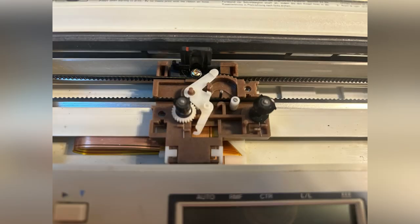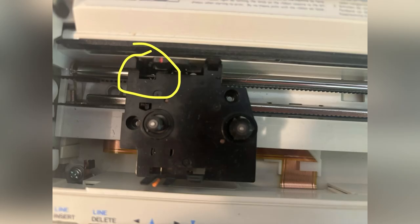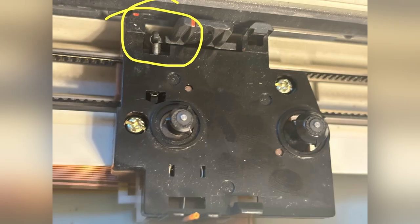Just shift it in from the side. Should your wheels be catapulted out, this is what the lower layer looks like. Once you assemble the part back together, you can see that this little spring will not automatically attach itself to the tooth of the read/write head — and that is what it should look like once you have successfully pulled it into place. That is the read/write head of the EP44.